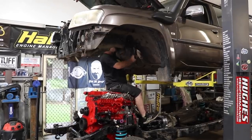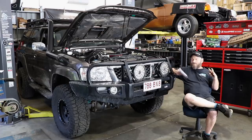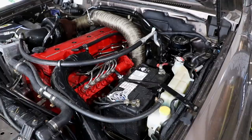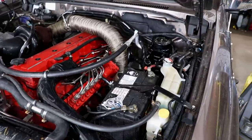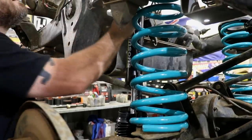We've weighed it and the front and rear weight distribution is actually very good - it's 55-45. The car isn't over GVM. It's probably one of the lighter Patrols around really, but it doesn't have any off-roading or camping gear in it, which is where a lot of weight can come from. It can be done with the weight kept in check. You'll notice I haven't added extra batteries, used aluminium where possible, and fuel pumps and filters are in the back of the car - we've tried to spread the weight out because front axle weight is where you get into trouble. Weight is okay if you use your brain and think about it.